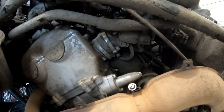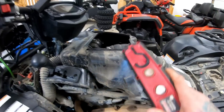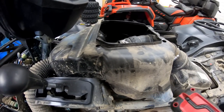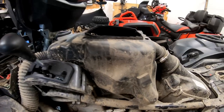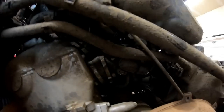So you'll see above the throttle body and everything, the injectors at the top. So if you don't have snorkels, just remove this box, and it's literally sitting right underneath it, straight up, really easy. Getting this box off, I think, is like two bolts, and then the back just sits in a grommet. Well, there's one bolt back there. So for people who don't have snorkels, much easier job for you. But I'm going to stick my mitts in there and see if I can unclip it.